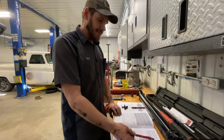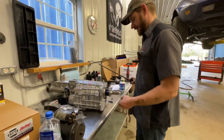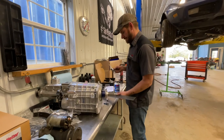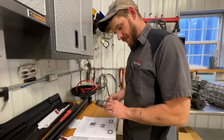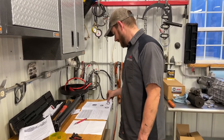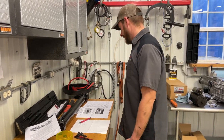The next measurement is the distance between the bearing face and the mounting surface of the transmission. We don't have any shims back here. We measured that distance and got 2.561 to 2.562. The instructions say to take measurement A, which is 2.726, and subtract 2.562, which gives us 0.164. The ideal gap we want is 0.150, so we're only 14 thousandths away from perfect — which is fine. We don't need to add a shim.